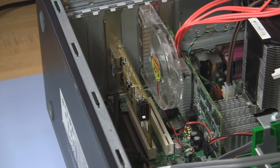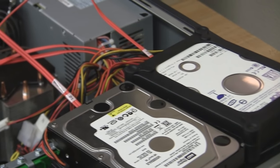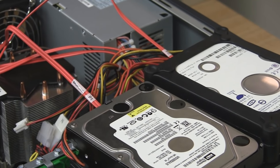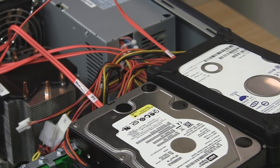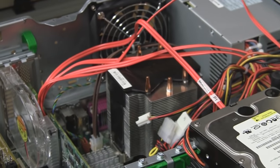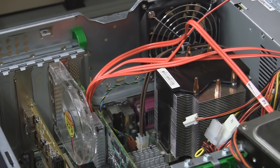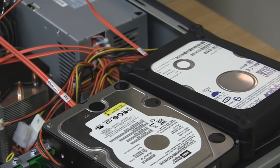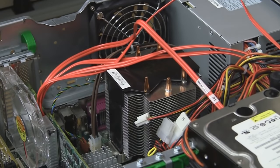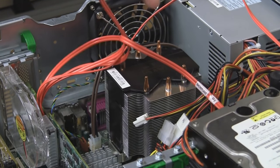Right now connected to the card we have two SATA drives. We're going to change this when we get into production — we'll actually use laptop two-and-a-half-inch drives. That way you don't pull as much power from the power supply and possibly exceed the power supply capacity limitations. In this case we're going to demo it with just two SATA hard drives, though we could very easily do this with four, since this is a four-channel controller. You can see there are two additional SATA connectors.